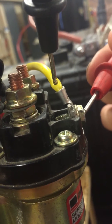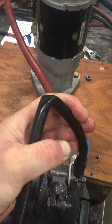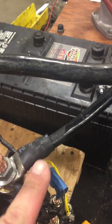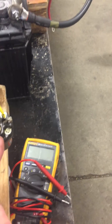And that's a simple solving of a voltage drop problem. Now what I wanted to point out in addition to that is this wire right here — it's hard to tell, but this is a piece of air brake hose. You can see that it bends just like air brake. I put this here so that students can look at this wire and say, 'I found the problem.' But what they don't know is I put a piece of phone line from the lug through the center of the wire all the way down to this lug. That phone line, while it won't carry any current, will allow me to see voltage through it so I can diagnose this problem.